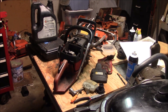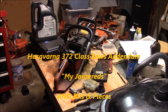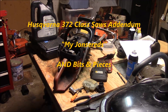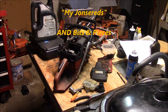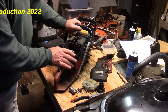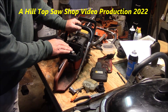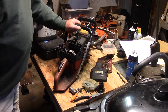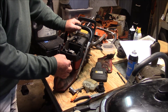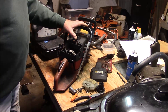Got a little bit of gas in there. Now to those people who don't like primer bulbs - boo on you - because this is where the primer bulb would make a big difference. By priming it you could make sure the gas is into the carburetor. That thing is dry as a bone in there, and even while I choke it, the chances of me being able to draw gas up and get it wet fast is probably pretty slim.